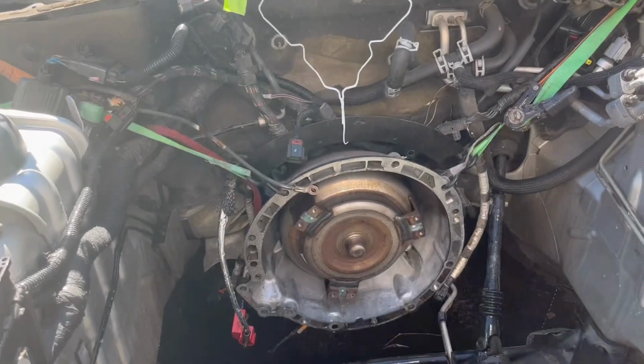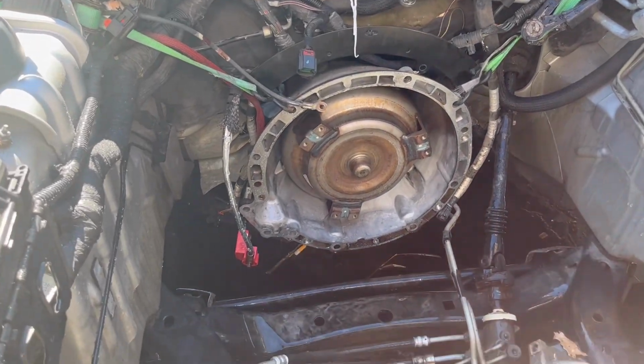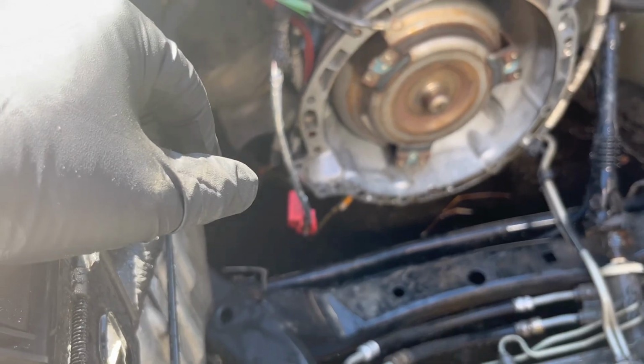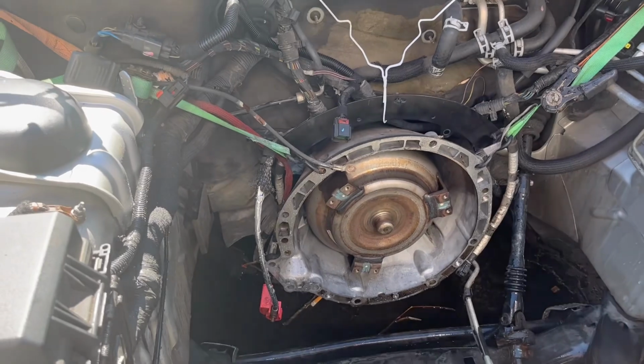He's been in the process of re-looming the wiring harness. And we had to replace the wire going to the starter. I had like a fusible link set up on it and it got a little bit of heat from the header. Just a little bit. So we're thinking that was part of the problem with the battery drain. So we got that replaced.